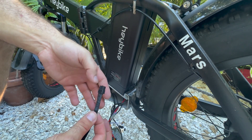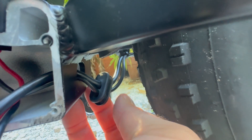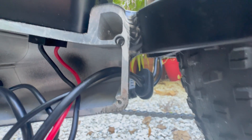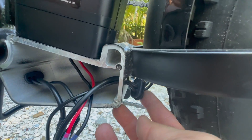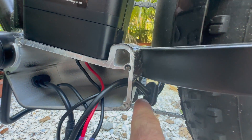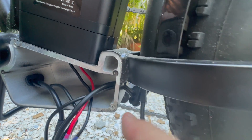I'm going to run my XT60 up through the connection here. Something to think about — this connector can be punched on this side if you want to make it wider and open up that port. It's meant for weatherproofing, which we understand. Most of the time, unless you're dumping this in mud puddles, you should be fine. There are openings on the plate that pretty much nullify whatever weatherproof factor this brings, so it's more of a security thing. For this application we're not going to punch it — we're just going to stick it in.